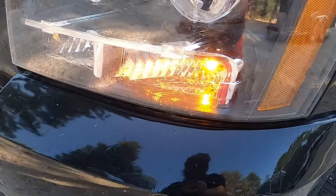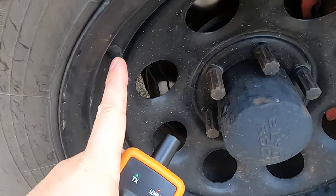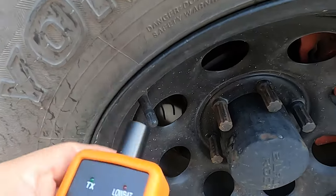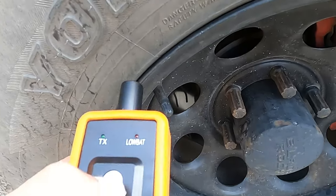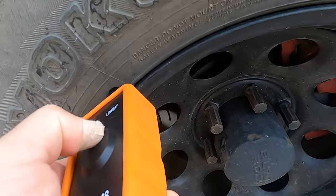As you can see the front left corner light is lit up. Got the valve stem here — that means the tire pressure sensor will be right here behind the wheel. So we're gonna push the tool here. There we go, that side's learned.